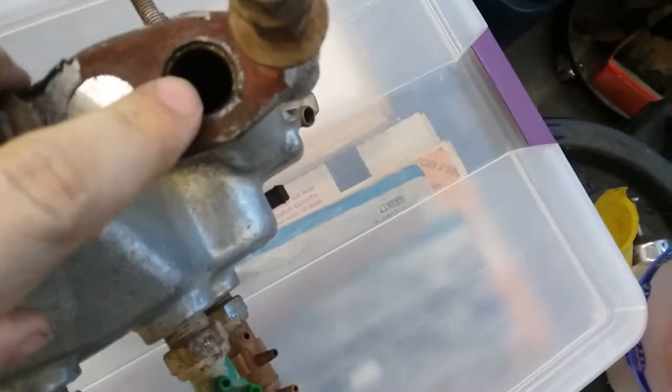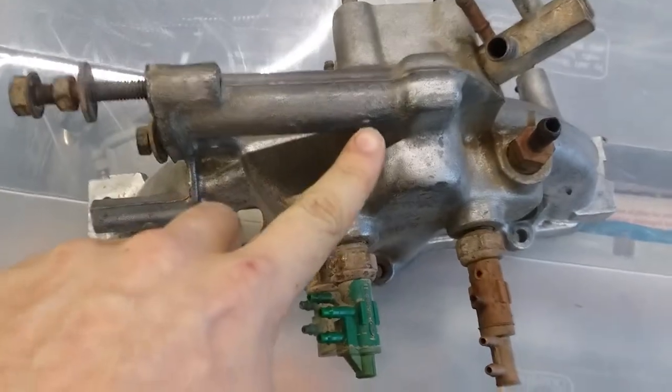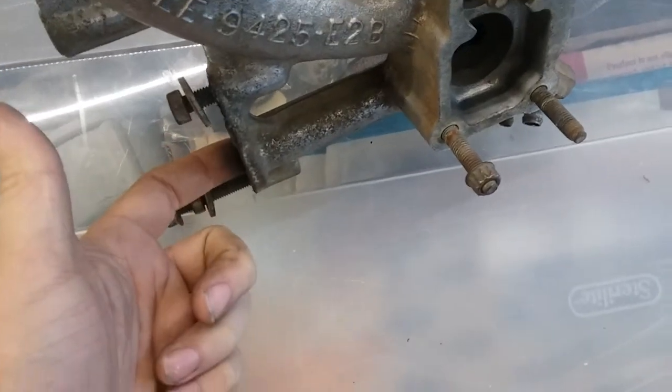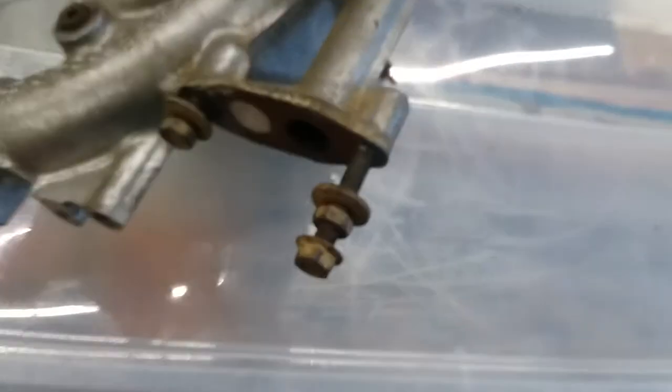When I got this, someone had snipped off the EGR but left the valve on, so this whole pipe was plugged with carbon — full of soot, nothing but soot. You run a screwdriver in and out of there in a parts washer until the stuff starts flowing out. Because if you hold it like this and you're running your parts cleaner down into that bottom hole, it will fill this up. If it's packed shut, it will fill that up and spill over the top. So you keep running a screwdriver in there, and as the parts washer is working, you'll see soot coming out this end. Once you break through the whole mold, you'll see all the soot go poof straight out the other end. It's pretty entertaining, but that's how you do it.